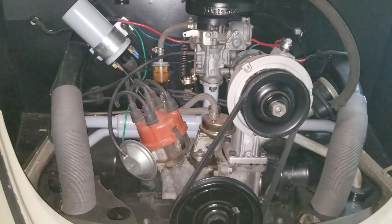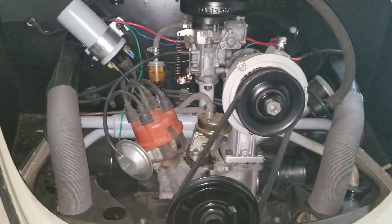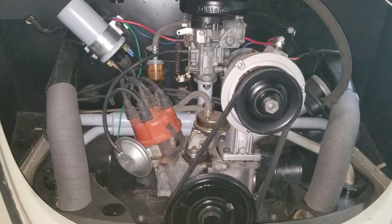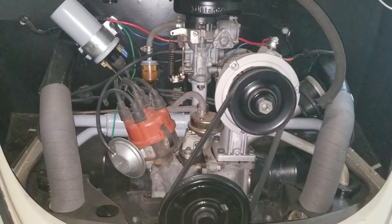So let's talk about the mods. The first thing you do is a 1384 kit — they call it 1384; years ago it was 1385, but they figured out it's actually 1384. The 1384 kit is the big bore cylinders, they slip on, and there's no machining necessary to put them on. That gives you a lot more torque from this engine. Before having those, you might not be able to really accelerate much in fourth gear and you'd have to drop to third. With the kit, you can be at 35 to 45 miles an hour in fourth, shift from third to fourth, and it'll actually still accelerate.